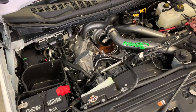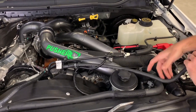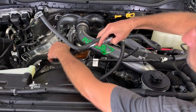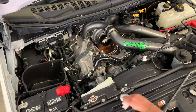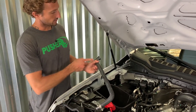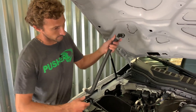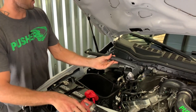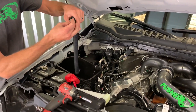Pull the connection off — you don't have to worry about saving clamps or anything, this kit comes with all new clamps. We're going to start with our larger assembly first. We always give you a little more hose than you need, just in case. I've trimmed that to length already, so we're just going to put our hose clamps in place and tighten them. With the 90-degree fitting, if you set this on a table, that's pretty much the orientation it's going to be on — go ahead and tighten that as well.